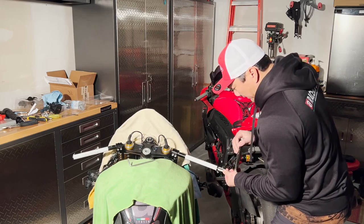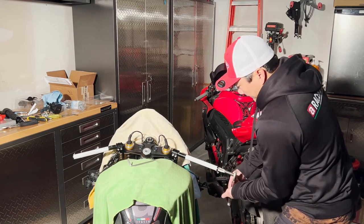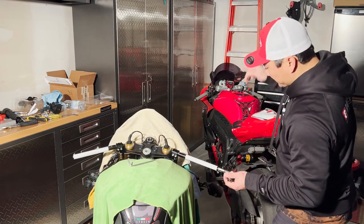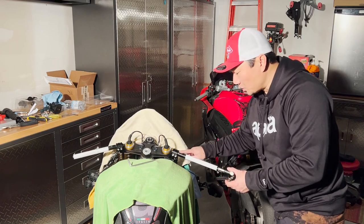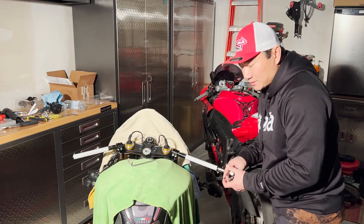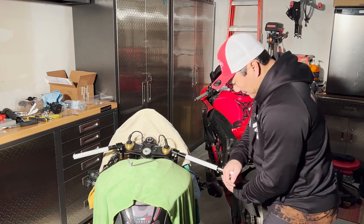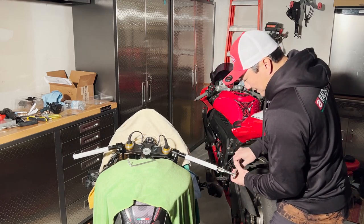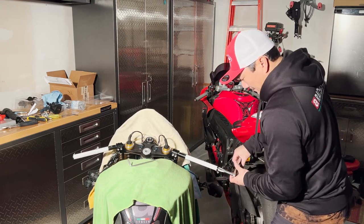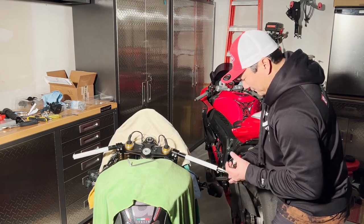Again, you want to do it gently, slowly. See, I would not have thought to do it this other way. I have drill bits over there, but I wasn't sure how to hold this bar to get those holes drilled. So the common sense is to put it in place, tighten it all up, and just drill it. Did that seem to work? Yeah, just go back, reverse the tap to get all the shavings off.